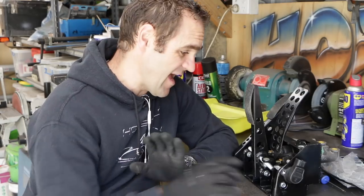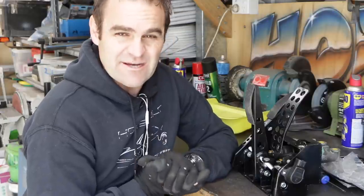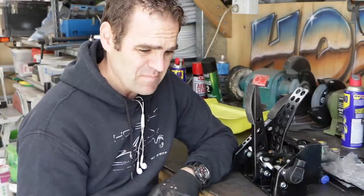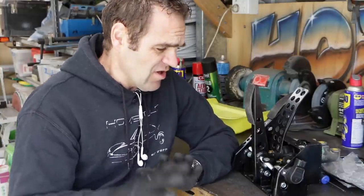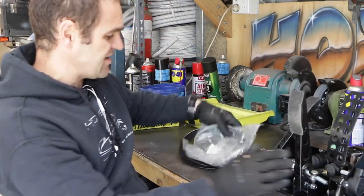That is sorted out, and it's a good thing I have two springs. It is necessary to have two springs in this just for redundancy — so if one spring goes I don't have a runaway throttle. That is good, that is sorted. The next thing I'm going to tackle now is the clutch.